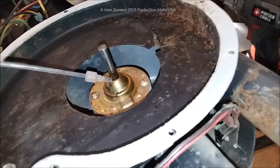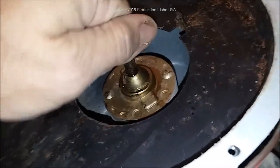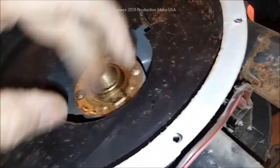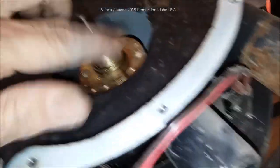What I've done here is take standard three-in-one oil and dripped it right in here where it'll soak into the bearing. I'm going to work the sleeve back and forth because these are just sleeve bearings, getting new oil into the bearing.